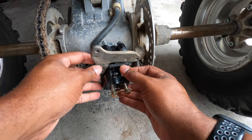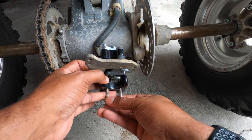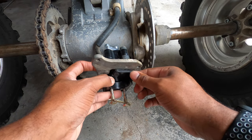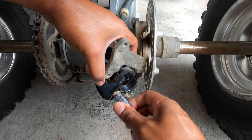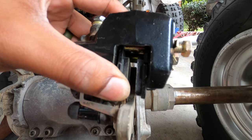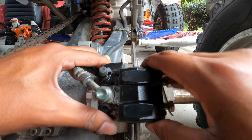From here you just need to work to align the brake pads with the sliding pins. Some people just get it right away — and then you've got people like me that are just on the struggle bus. You want to spread the brake pads apart so that it will fit on the brake rotor — just like that.